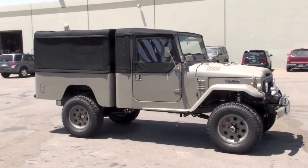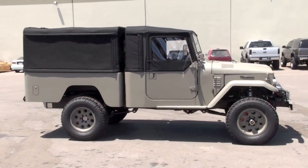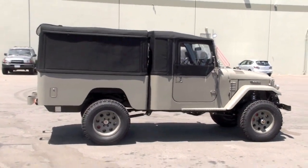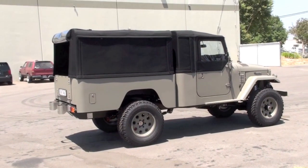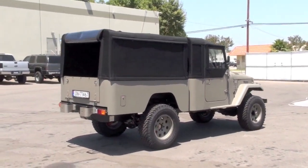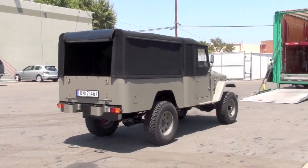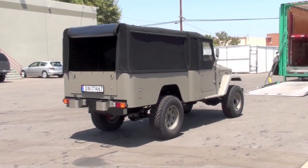This truck's built with the 5.3 LS series fuel injected V8. The transmission on this truck is the automatic, the GM 4L65E, to the Atlas split part-time four-wheel drive transfer case. Rear axles, the typical Dynatrac Dana 60 based Pro Rock high pinion. The front is our usual Dana 44, again by Dynatrac, with the fine spline superior axle internals.